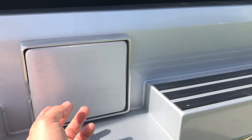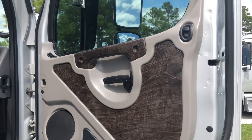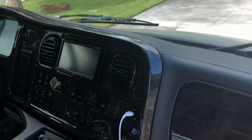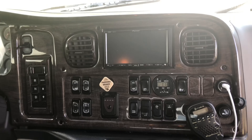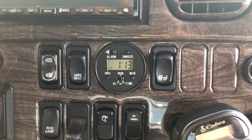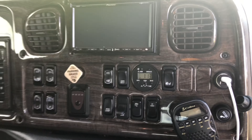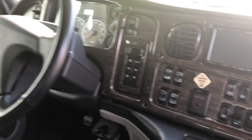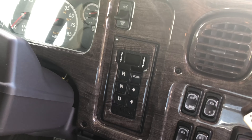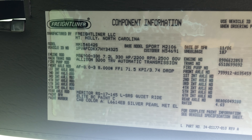Twin 50-gallon tanks on each side. Step off to the inside here — full deluxe interior. You see the door with the wood grain dash panel. It's got a timer, which is your normal timer for a trucker — you're only allowed to drive 12 hours. If you have the gauge instead, it's going to be the air gauge for your optional hitch. It's a six-speed Allison — I believe it's a 3200 — 330 horsepower.